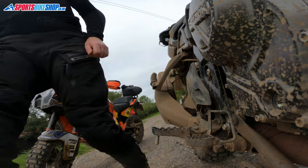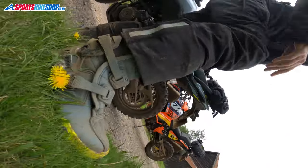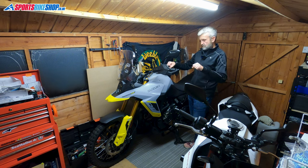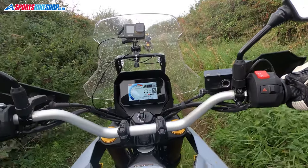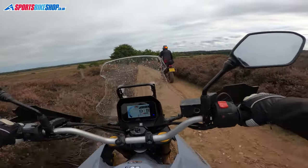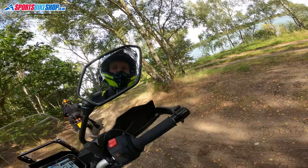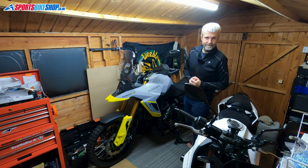So took the rubbers out of there, moved the gear lever around because I wore motocross boots on the day, so moved that up a spline to give myself some extra room for those heavier boots, and also moved the handlebars. In standard position, the sweep brings the bars back sort of lower and more towards the rider, but for a day of riding like that, I wanted to be stood up, which meant I wanted a bit more rise on the bars and also wanted them a bit further forward. So I undid the handlebar clamps, rotated them towards the front of the bike to give me more room in that position. Then I had to move the mirrors to suit that, so I could still see what was going on behind. There was also the small matter of 3.5 hours of cleaning.